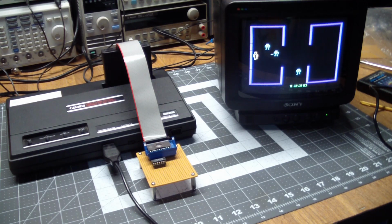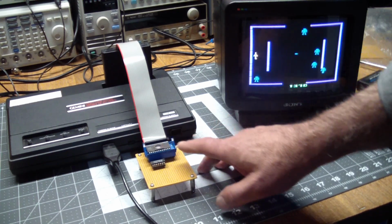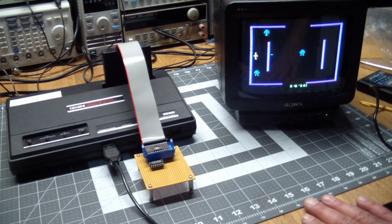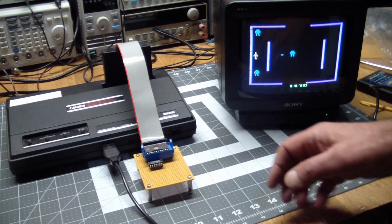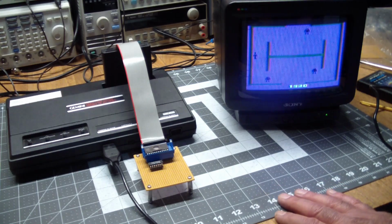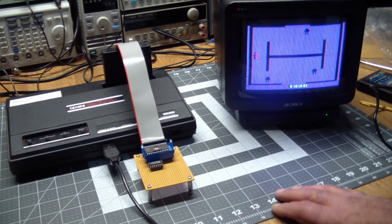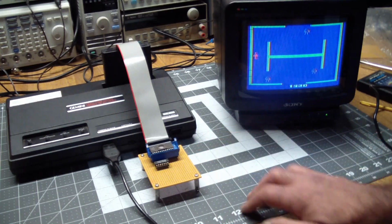The only question remaining is, I mentioned that you can also do 2K ROMs. The way you do 2K ROMs is you can just burn one copy into the upper side of the 2732. You could put 2716s in here, but then I'd have to have a bunch of jumpers to configure it, because it has some other pins that need different inputs. So even if you have a 2K ROM, the easiest thing to do is to take two 2K images, concatenate them, and burn them in here. To do it correctly, you would need a 2K file filled with FFs concatenated with the actual file, but the easiest way is to double up the image, make a 4K image out of two identical 2K images, and this will work too.